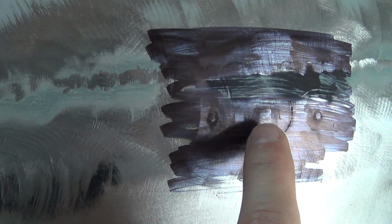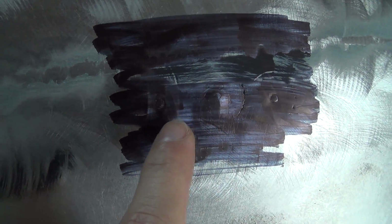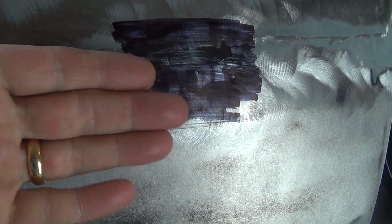All right, so I started out putting some Sharpie on here. You can see the high spot right there. So we're going to go ahead and hit it with the shrinking disc and see what happens. In the video they have online, they use that blue color and stuff. I don't know what that stuff is called. I'm trying the Sharpie. We'll see. Hopefully it doesn't just get all over the disc and screw it up. But anyway, we're going to give it a try.